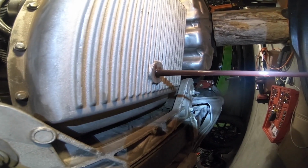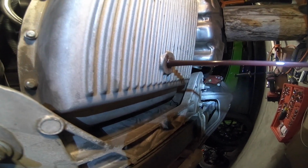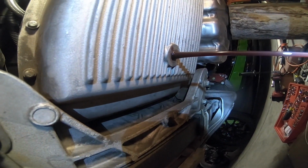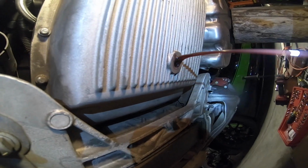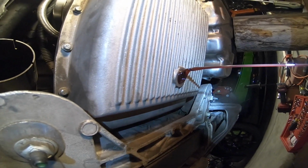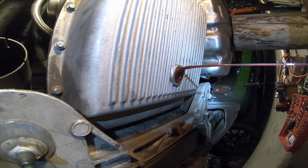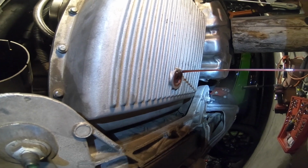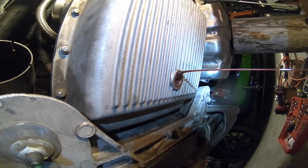So the reason why this tranny messed up, I don't know if I mentioned it earlier, but I got a Ron Davis radiator that's supposed to support the transmission and the motor. Shouldn't have no overheating problems, but unfortunately it didn't support it. I took a half-hour drive, just driving it normal, and when I got to my friend's house, it was at 280 degrees. So it got really, really hot. And that's when I lost third gear. But now we're gonna replace it.